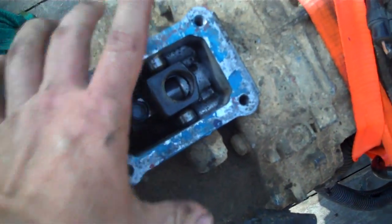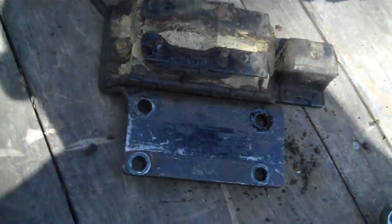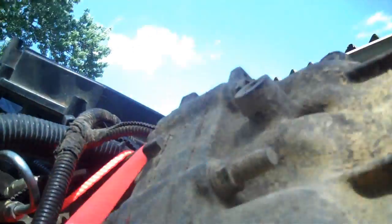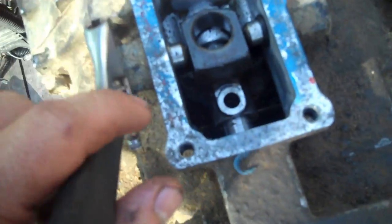We've got to take this out next and take these out. You can see under here that plate where the transmission mount came from. You've got two bolts right here that will have to come off to take the whole housing off — that's the reason we need to pull that. So next in line, pulling this assembly right here and that bolt down the side there.